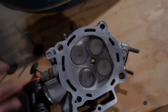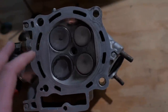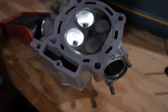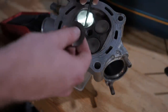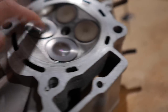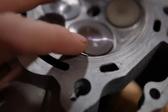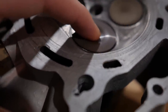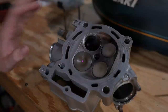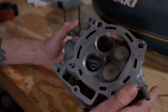I tried replacing the valves. You can put blue compound or sharpie marker on the valve, give it a couple taps, see if it's high or low on the seat — but I went ahead and threw two brand new $90 Honda valves in. With these valves fully seated, we shouldn't be getting any leakage at all. But you can still see light coming through even with a little force down on them. The head is not warped — I checked it with a flat blade, the seats are flush inside the tunnel, not lifted or cracked — but that is what you get with cheap aftermarket engine components from a non-brand-name source. The valve seats are simply bad.